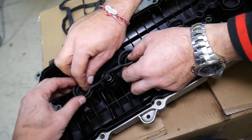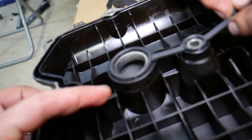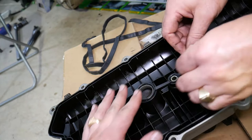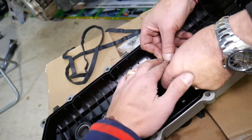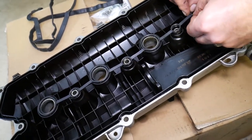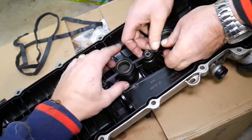Gently, don't break the valve cover. Get it started on each side and it will be in. Now install the spark plug well gasket — start on one side. Notice how thick the new gasket is compared to the old flat one. That thickness is what prevents oil leaks. Make sure everything is dry and the canals are clean — no contamination, otherwise you'll still have leaks.